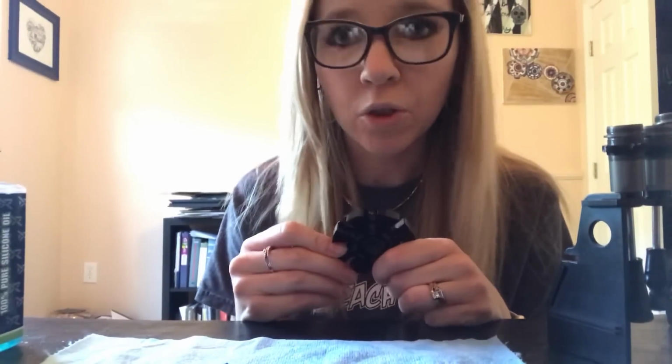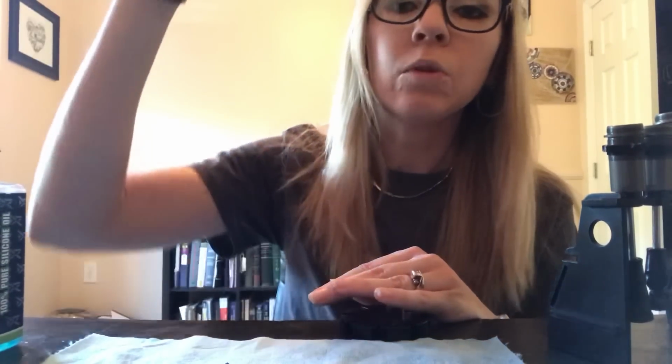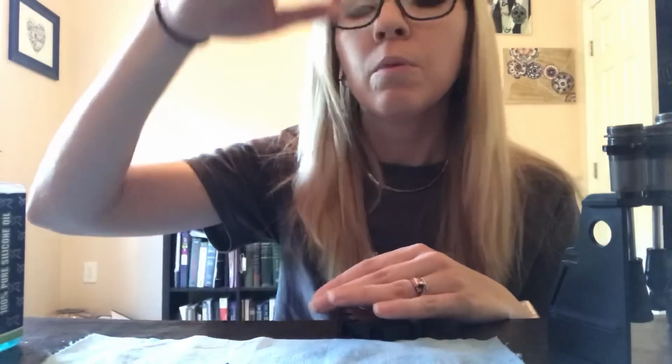And if you're not familiar with rebound, what it does on the track is this: if you have a car with no rebound, you set your shocks dead, so to speak, what will happen is when your car is driving or you go over a jump, your car just kind of settles. If you have a shock with a lot of rebound though, when you go over a jump and you land, your shock's going to want to bounce a lot because the shock shaft is being pushed out quickly. Because that's happening, when you land, your car's going to be very bouncy.